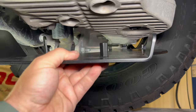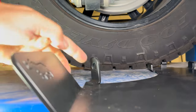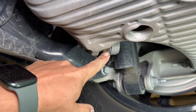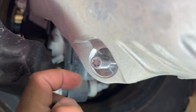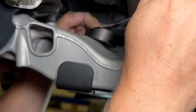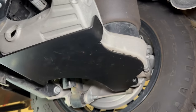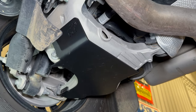They hook on on that side and then you bring them up. There's a little tab right here that's going to slide in where your rear sway bar link is. I was able to get this off just with a 21 millimeter socket — I did not need the Torx for that. I have that wedge and bolt started now, I just need to tighten it up. Everything is tightened up and installed. This should offer plenty of protection for the lower control arm as well as a smooth surface for the rocks to slide on.